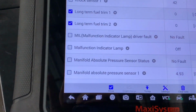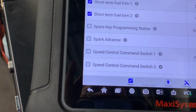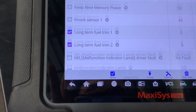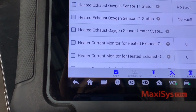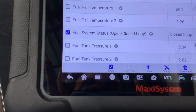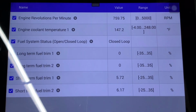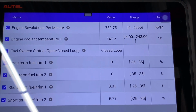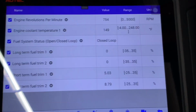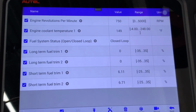So we got both long terms, which are at 0. I might need to look for the status of closed loop to show whether it's in open loop or closed loop. So let me look for that. Okay, just right here. So it's in closed loop. And we got pretty normal fuel trim. So as you can see right now, everything is 100% normal. So this is 100% fixed. Again, if you have any lean codes and misfires on these cars, go for the coils. All right, guys. See you next time.